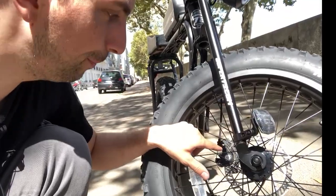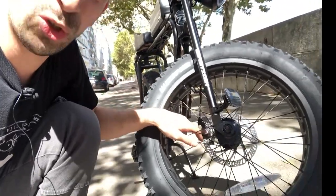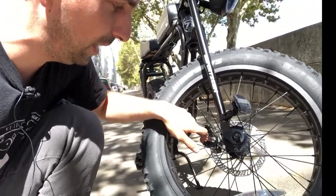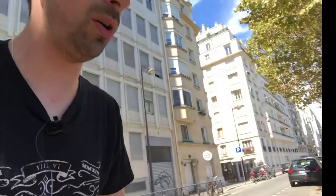When I received the bike, I thought that the front brake was too tight. So I tried to untie this screw here, but be careful not to unscrew it all the way because there is a little metallic ball and a spring, and if you unscrew it too far, the ball and spring will just jump away and you will lose it.